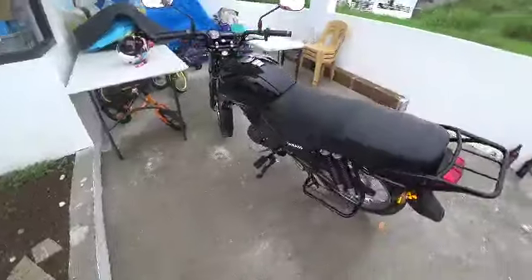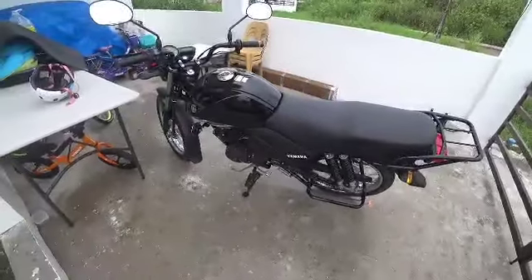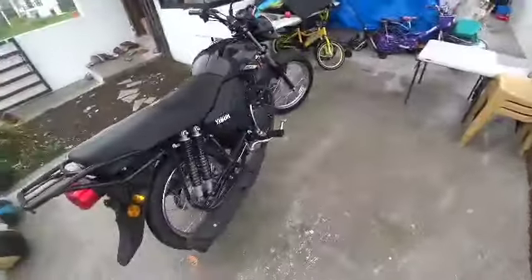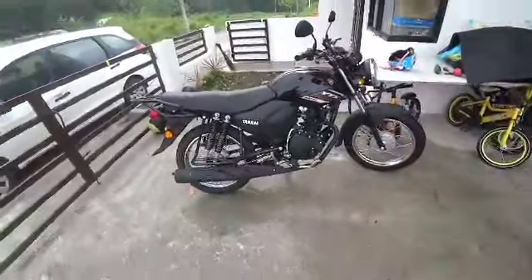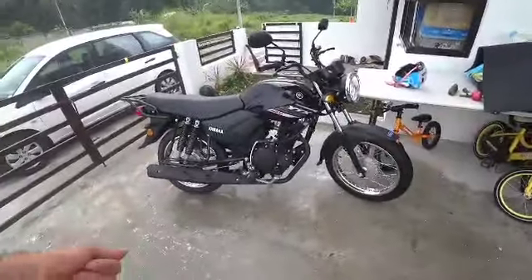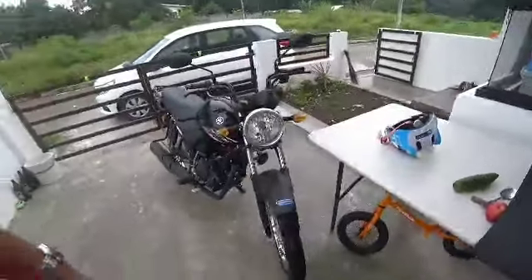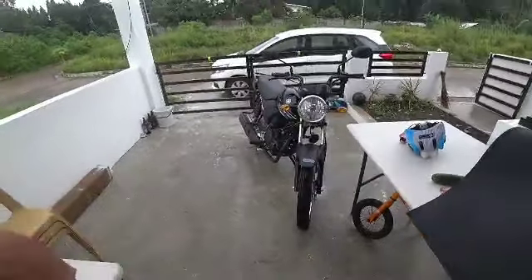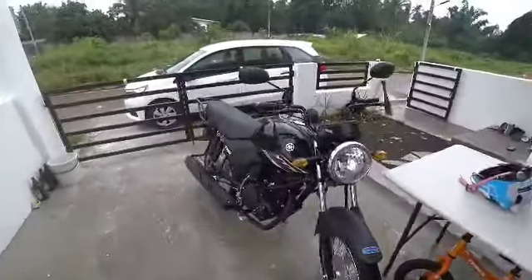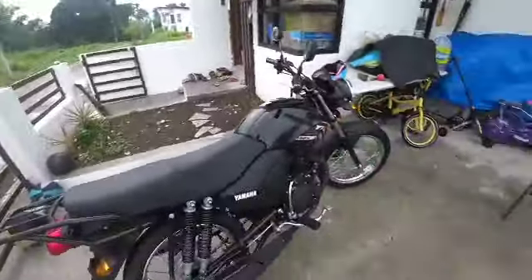Something you guys need to know when buying a motorcycle here — a lot of these bikes are one-up and four-down. When you ride leisurely you can remember that, but when you get in trouble your brain reverts to what you know, and instead of going down a gear you go up and lose power. I specifically asked if this one is down to downshift and up to upshift. Kick it all the way down to neutral, then kick up for first, up for second, up for third, up for fourth.